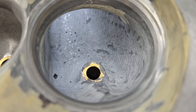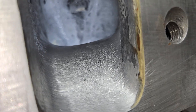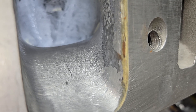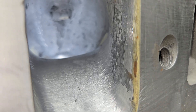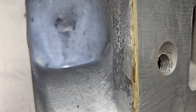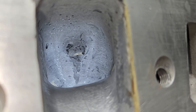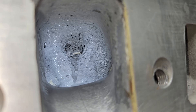Let's flip this over so you get a different look. I really haven't done anything to the short side — it's actually working pretty well the way it is, just a little sanding. The short side is exactly the way you saw it last time because I need it as big and wide as I possibly can make it. It's a 6-degree head; all the air wants to be on the short side, so in order to get your air speeds at a reasonable level it needs to be wide. The bowl is pretty much a wreck as far as air speeds, so we're going to shrink it up and get the air speeds a lot closer to where they need to be, hopefully without losing too many CFM.